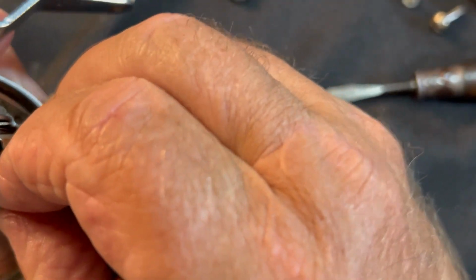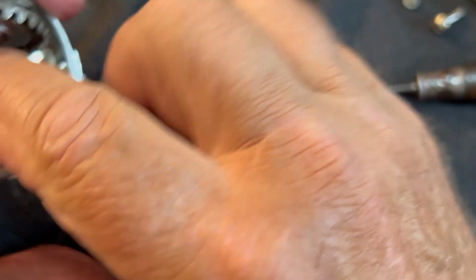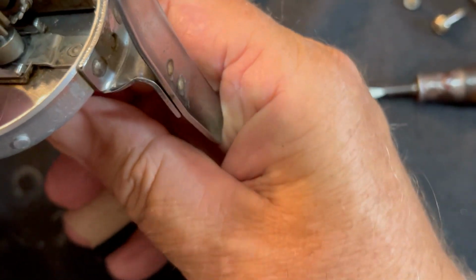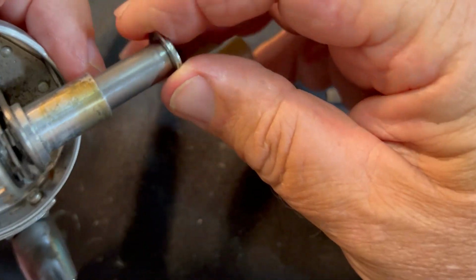Okay, let's try this again. Set the cup in facing down, like so. Next goes the gear. Gear goes on, and then we're going to slide this up. I got to get the axle shaft to rotate around until it goes through like that. Okay, and now if you look, I've still managed to let this thing slip a little bit.